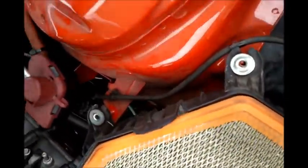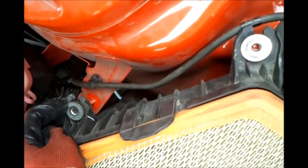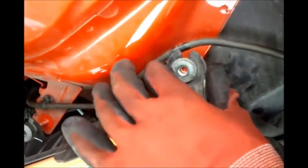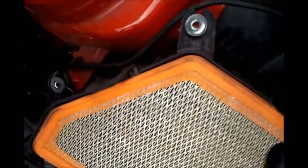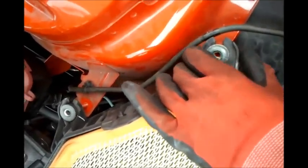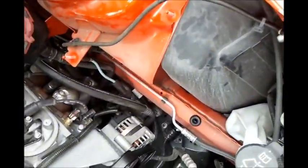One problem I ran into: you've got these metal washers with an integrated rubber bushing underneath — for vibration damping. One of them was really stuck on the post, so I couldn't get the box up. Theoretically it should come up, but if your car gets stuck like mine, just use brute force and reef on the bracket, try not to break anything. Then you should be able to pull up and lift the entire air box out of the engine compartment.